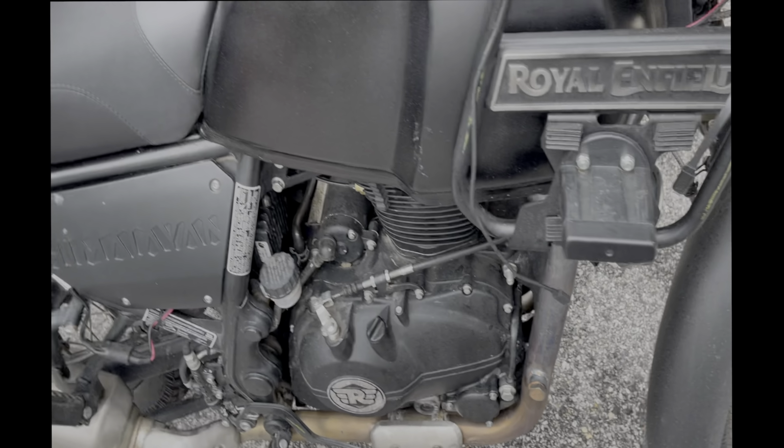And what's the RPM right here? So you're at 3,200, and torque drops off really at like 5,500. You can probably see it maybe at 2,500. Well, this is a 100% run. If I tried to give it throttle below there, there's a little bit of delay between when you can get to 100%, the bike will accept that based on how much air it's sucking, the cams, and if it has secondary throttle plates, which I don't think this one does.